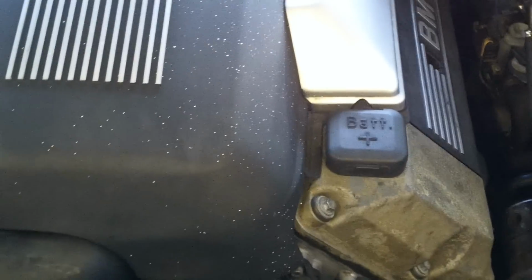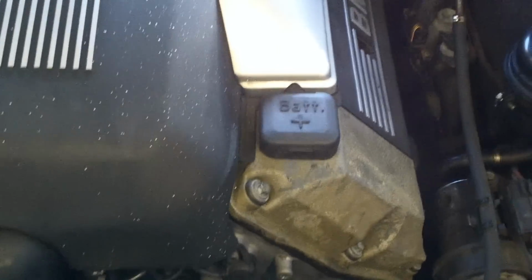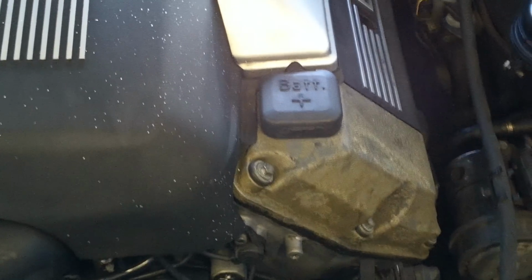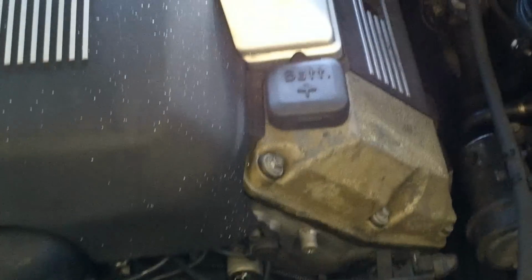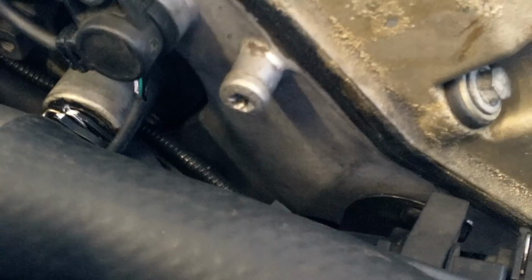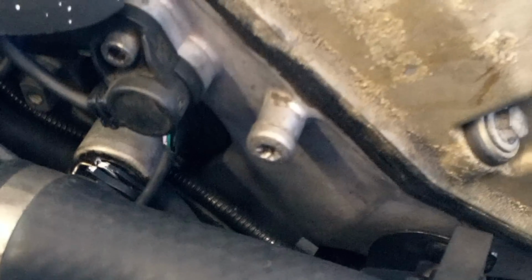Once that pin is in and you have the oiling rails off the intake camshafts, you're going to want to take your wrench, I think it's a 27 millimeter, and rotate the cam back to the end stop, which is counterclockwise. And I noticed this after the fact, but you see these little plugs? This one's a Torx bit that takes that. You're going to want to take that plug out. It's actually an alignment tool to make sure you're good.